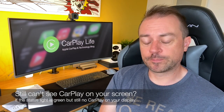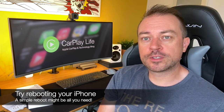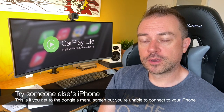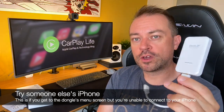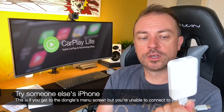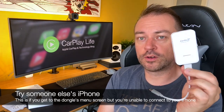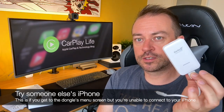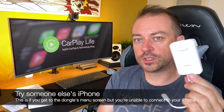There are a couple of things to try if the phone seems to be the issue. Do a reboot of your iPhone and see if that helps. Try someone else's iPhone as well to see if that connects. But usually if that red light is flashing, it's not a problem with the iPhone — it's a problem with the dongle and the receiver you're plugging it into. You need to get the light green for your phone to even recognize it.